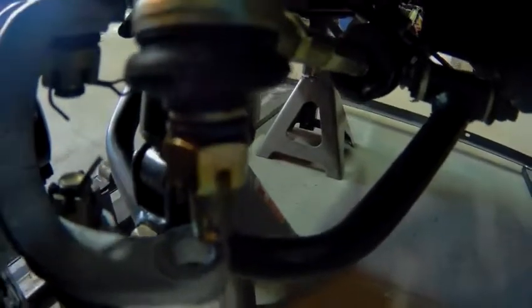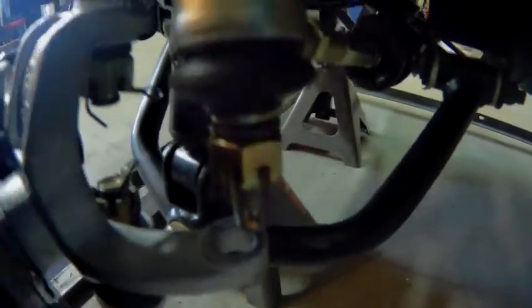So it'll drop into that hole and then when I tighten that down I'll use a cotter key — that I showed previously in the hardware — through this little hole in that post, to keep that castle nut from backing off.